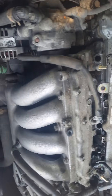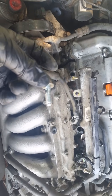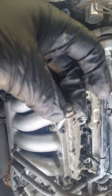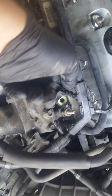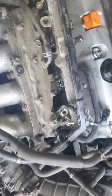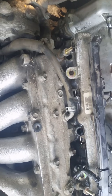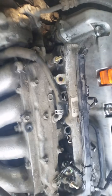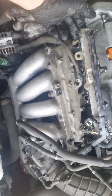You have two bolts — you can see the stud from one right here. It really doesn't matter if the nut comes off or if the stud comes off, it makes no difference. Don't fret if you pull the stud out instead of the nut. I had one where the nut came out and one where the stud came out. Then you just kind of rock it back and forth, trying to pull it up. Be very gentle — you don't want to break the fuel injector.